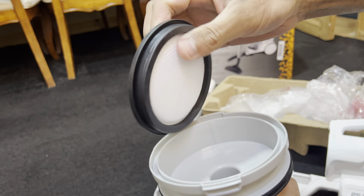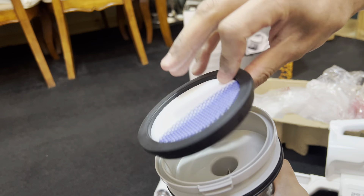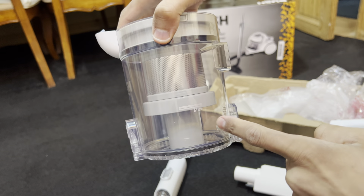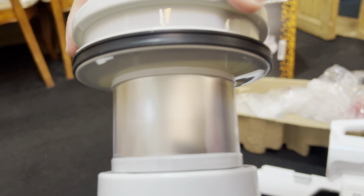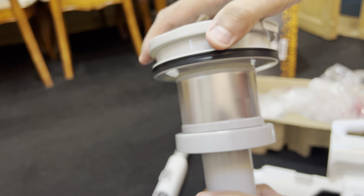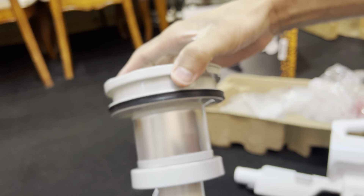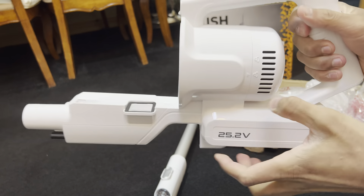Here's the pre-motor filter — it's got a really thick rubber gasket around the perimeter so it'll be nicely sealed. It looks like a dual cyclonic setup: dirt enters the bin, a cyclonic vortex captures it at the bottom, and any remaining fine dust passes through the micro holes in the shroud and gets separated by a secondary cyclone inside. I count two or three cyclones in total — I'm impressed with that for a budget stick vacuum. There's a big fat motor in there since it's not brushless.